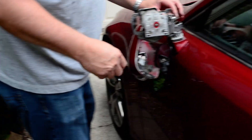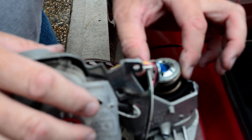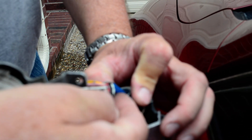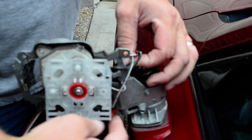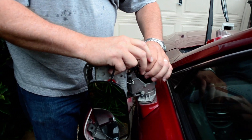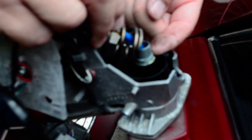Here's the simple thing that's really happened. All this is is a compression nut, and you notice the shaft looks like there's something missing — there's a piece that goes in there. Some guys have drilled a hole and pushed it down, but really, if I pull this back and show you, the shaft is bigger a little bit farther down. What's happened is this clip has popped up off of there — that's all that's happened, this top clip has popped up.